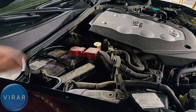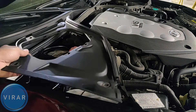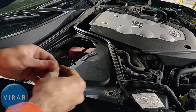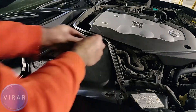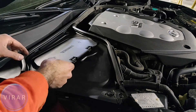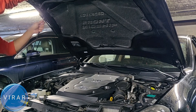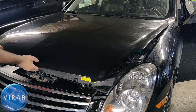Now we can put the other black panel on — it's got its own five clips, so let's put all those five clips back on as well. Make sure everything is aligned and all the holes are aligned properly, then put the five clips back on. After that, put that other panel back on and that's pretty much it. In order to close the hood, first push the hood a little bit, get the rod out, put the rod back in its place, lower the hood, and then slam it shut.